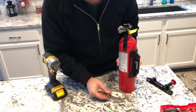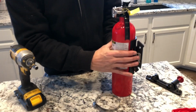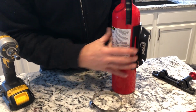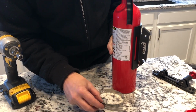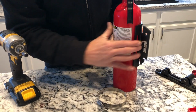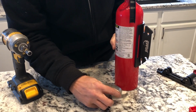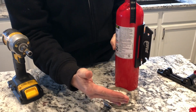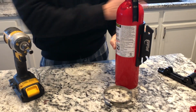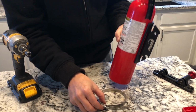As you mount this hose clamp on, there's a couple different ways you can do it. So I'm gonna be doing this on the passenger side, which means that the hose clamps and things like that, I want to try and be towards the window. So if this is the roll bar, imagine this is the roll bar here. These fittings, the excess, I want to be away towards the window, not on the inside, because I don't want it to catch on people's hands, gear, things like that.